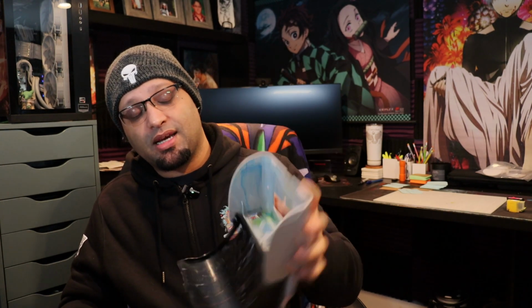And there'll be times that I'll start getting clogs in the ink, and you can see that the ink is going bad because I left it open. It stayed open for 2-3 days, and then I'll drain it because I don't dare to use that ink, and I don't want to risk pushing a little clog into the printer. The other thing is, when I'm shaking them, if I forgot to close it, don't ask me how I know, there'll be ink everywhere, as you can see. So that's why I don't recommend this one.